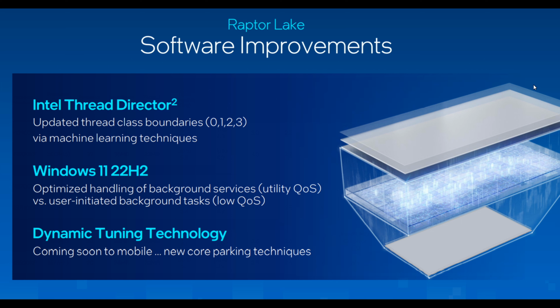Then the second thing they've got to do is ensure that, I'm going to quote one of Intel's videos right now, to spill over multi-threaded work to less performant cores. Performant is a fancy way of saying lower performing cores, or E cores. So less performant cores would be E cores, higher performant cores would be P cores. So you want to ensure the spillover of the multi-threaded workload onto the E cores, especially with multi-threaded performance. And the last thing you want to do is use SMT siblings, so basically the P cores' hyper-threaded siblings, last, to avoid any contention that could impact performance. So you want hyper-threading to be used as a last priority.